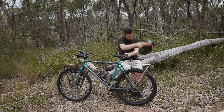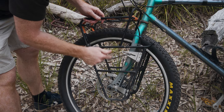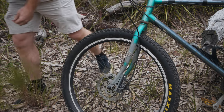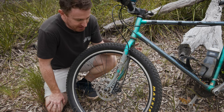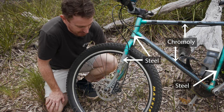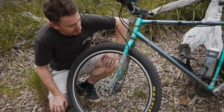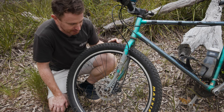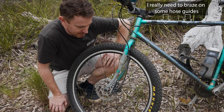Let me take my helmet off. I'll take the front rack off and we'll have a closer look. Here we have our modified front forks. One thing to note is these are steel forks — I got this bike with a heap of steel on it because it's the only thing I knew how to weld. First step, I had to buy some new wheels with discs on them. I ended up buying front and rear for 50 bucks off Facebook Marketplace. Once I had the wheels, I had to make sure they actually fit in between the forks because the clearance is super tight. I don't know if all forks will work, but these ones did.